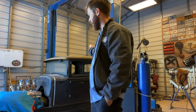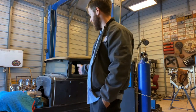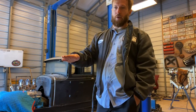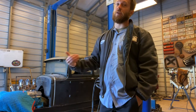Then I can put the body back on after I finish welding the feet. So body back on, bolts in. I need to get a welting, which looks like a canvas belt with some gunk on it that makes it weather resistant, I guess. That will sit on top of the frame, and then I can pop holes in it wherever the pass-throughs are, but it just prevents metal on metal contact, which will be nice. But I get that done and get all those bolted in, then I'll have 8 body bolts in, and then I can start building the sub rails.